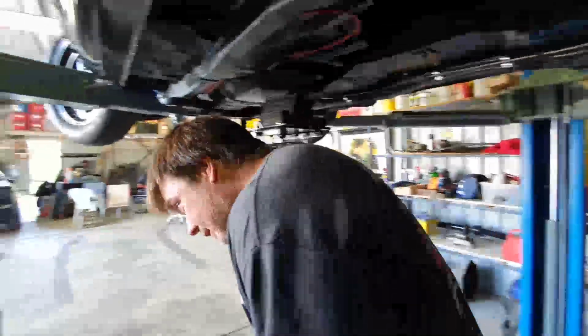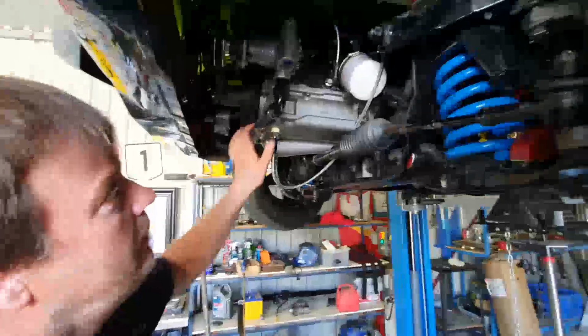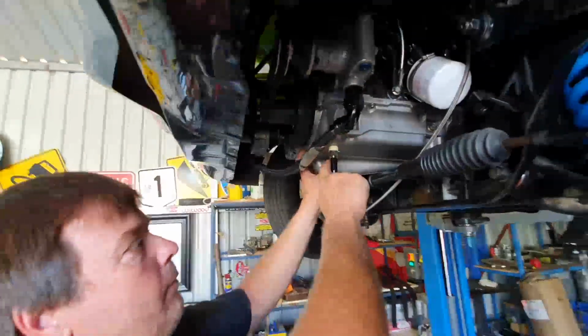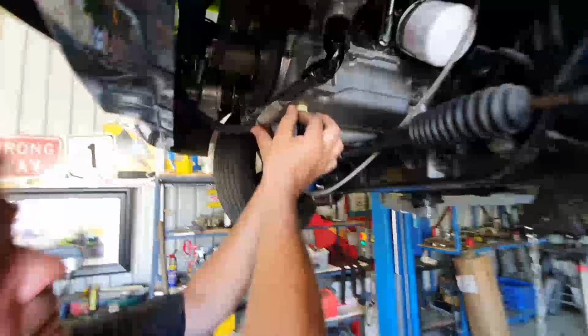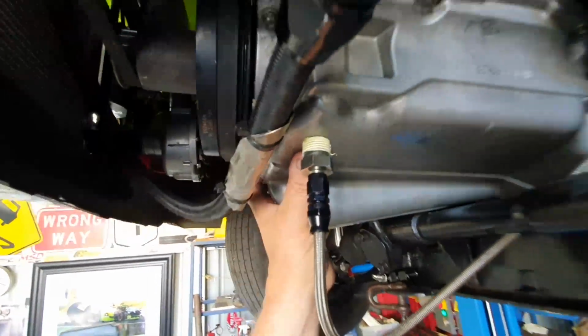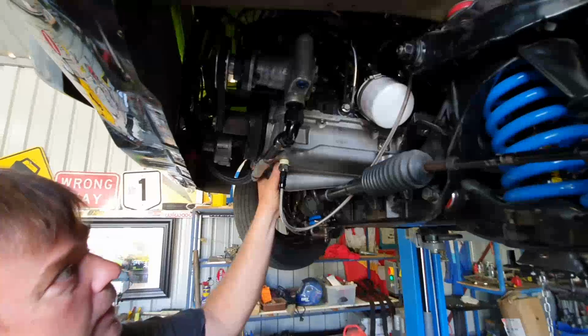One other thing a few people have asked about is the car's a bit smoky sometimes on the line. Well, we've got a horsepower junkie billet oil pump in here, makes pretty huge oil pressure. And we had to drill a hole in here, and that's where we adjust it from. It's got a little grub screw, and we raise and lower the oil pressure through this little window that we've tapped in there.